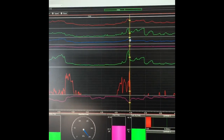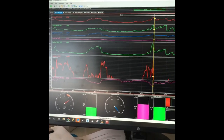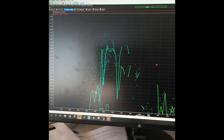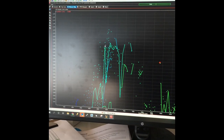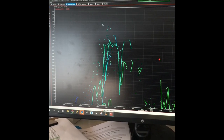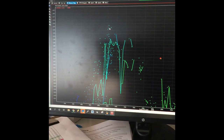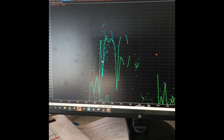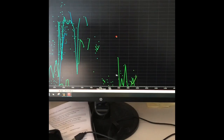My lambda looks pretty good, but it needed a lot of fuel added here. This is a histogram - it shows from 4,000 to 7,000 RPM I'm getting blue-green, meaning a little lean: 1.04 lambda, about 15.5 to 16.1 AFR up here. So I needed to add a lot of fuel still - I put 20% in before this run and I'm still hanging up there.